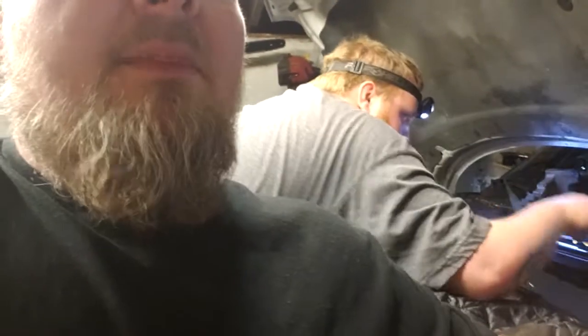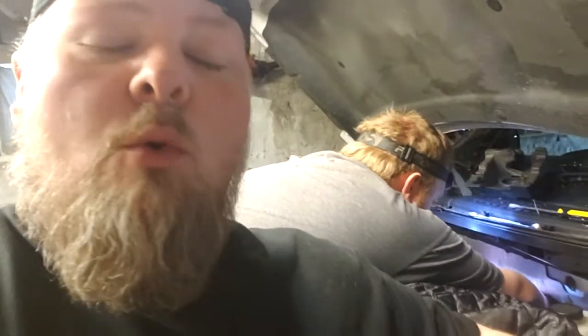The symptoms I was having, this is my vehicle, was it takes longer to start. The spool up is lagging. And it just died. The other symptom is it just wouldn't start. You turn the key, and nothing. You have to turn the key off because it's electronic. Then the other symptom is it will start up after cool down. I came back home after work one day, and the next day I tried to see if it starts. It starts, but it does hesitate still. So we're thinking that this is going bad, and we're going to do this high-pressure fuel pump today.